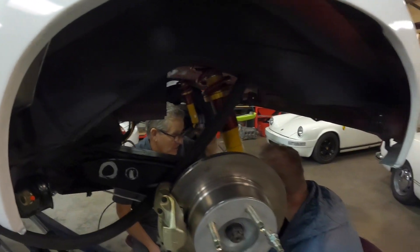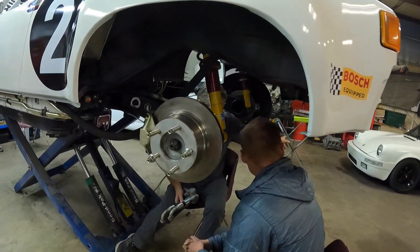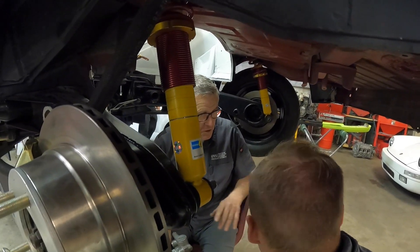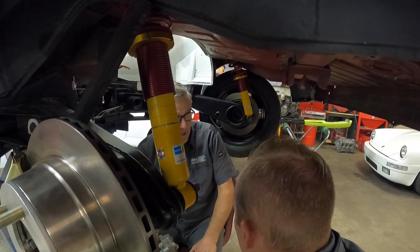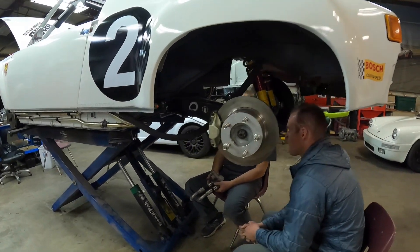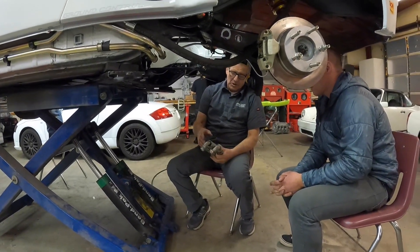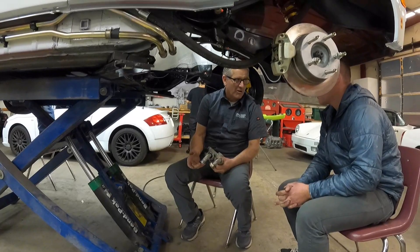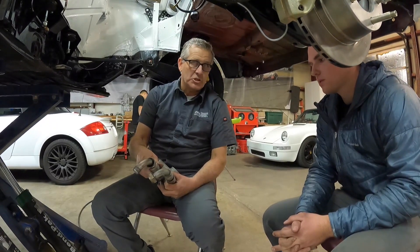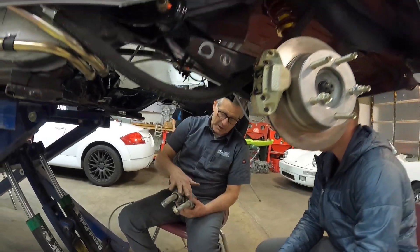That right there is 18 and a half — with a Carrera cooler in the other fender. I upgraded it to the radiator-style cooler that's in the '84 newer Carreras. From dry, nothing in the tubes — because I went through everything in that car — I've gotten 18 and a half quarts of oil in that car. It's a lot of oil. We won't run quite that much, but we'll be close. The lines are all 22 millimeter — they're German, not dash-12 or dash-16 — 22 millimeter, which is just short of an inch. We built all of them.